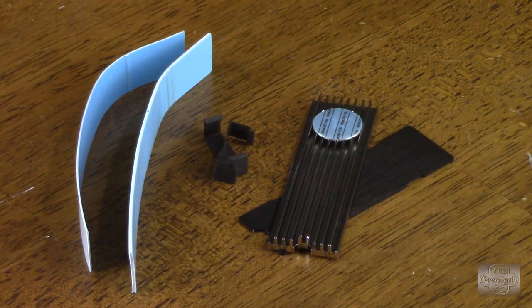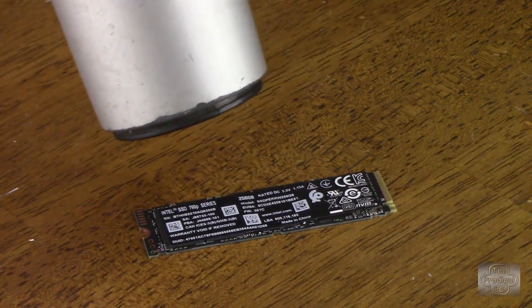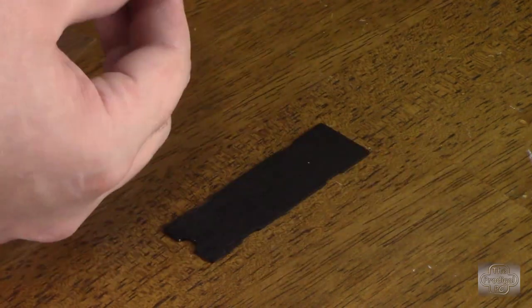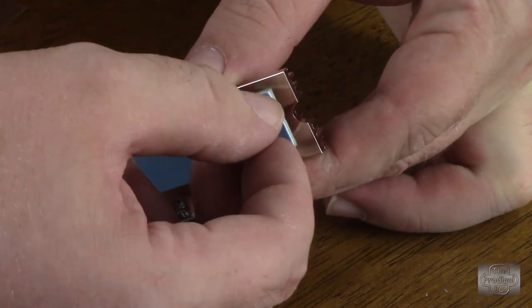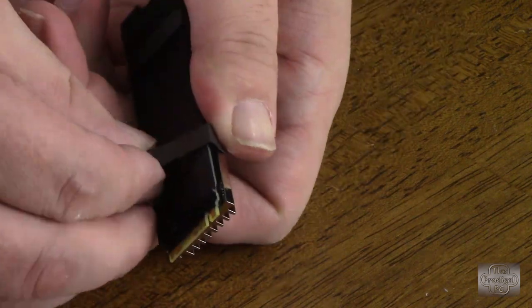First, let me show you how to install it on your M.2 drive. The heat sink kit comes with the main heat sink and back plate, clips to hold the assembly together, as well as a 0.5mm thermal pad for the back and 1mm pad for the front of the drive. Use a hair dryer on high or a heat gun on low from a distance to warm up the adhesive on the sticker already on the drive to make its removal easier. Next, measure and cut the thermal pads to the appropriate length for the heat sink and back plate. Adhere the 0.5mm thermal pad to the back plate and the 1mm thermal pad to the heat sink. Finally, carefully place the back plate and heat sink in place so that the notches for the screw down match up, and use the clips to hold the entire thing together. Be gentle and very deliberate when attaching the clips so as to prevent any scratching on the finish of the heat sink.